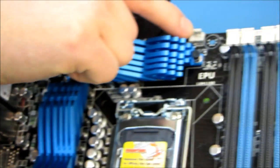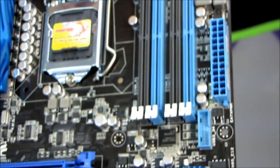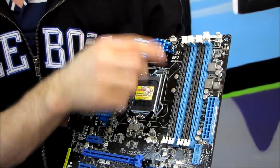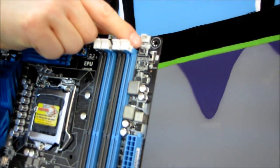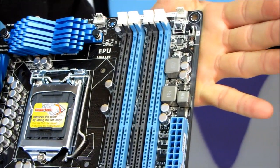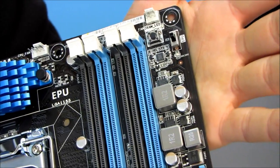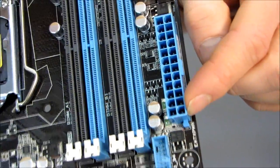We have our CPU four-pin connector here. We're using the quick-install ASUS-style DDR3 module slots, so that means this side does not open and close — you just open up the one side, slide in the module, close it, and clip it in. Here's the MemOK button. What you do is, with the system off, instead of pressing the power switch — which this one, unlike the deluxe version, does not have an onboard power switch — you press the MemOK button and it boots up the system with a safe setting for the memory, so you'll be sure to POST every time. It does work.